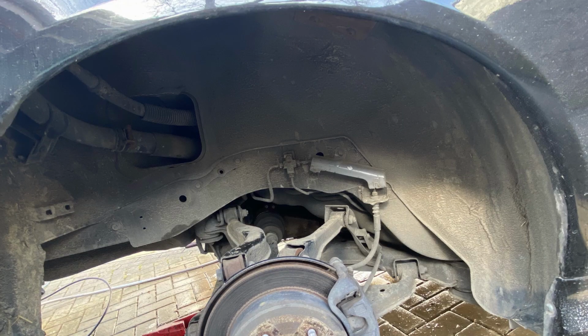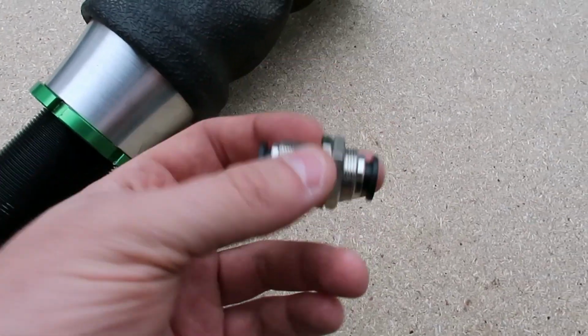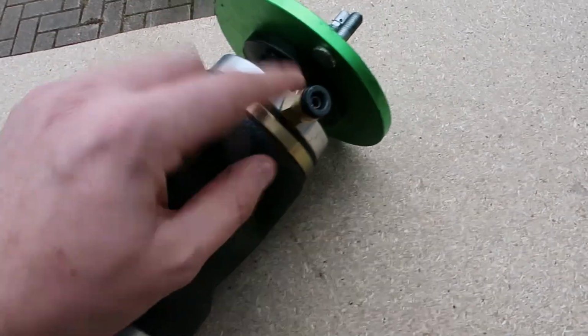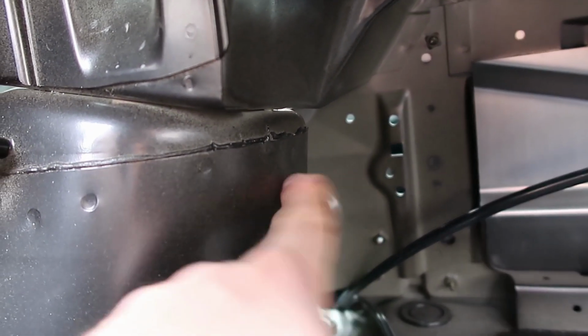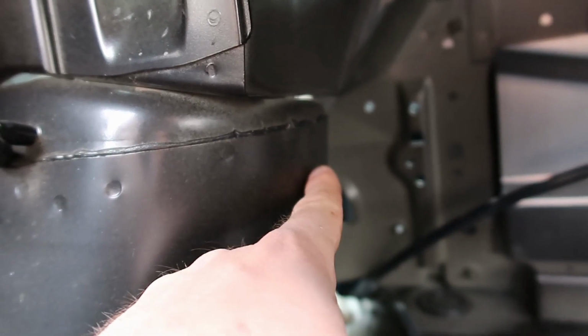So before sticking my head into the wheel well, I took the liberty of degreasing it and jet washing the whole thing. So I took it from this to this. I plan to use these bulkhead fittings to go from the inside of the car to the outside. But given that this is a fixed top and this is a fixed distance from it, and where it sits in the car, it sits pretty much about 5mm the other side of this strut here. So what I'm thinking of doing is just drill a hole through here, run a grommet in it, obviously to protect it from rust and things,